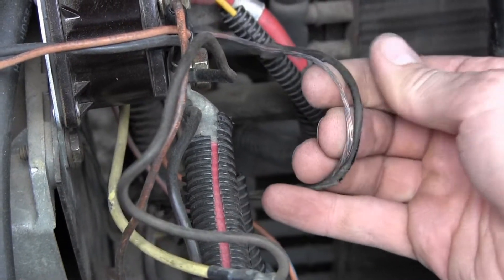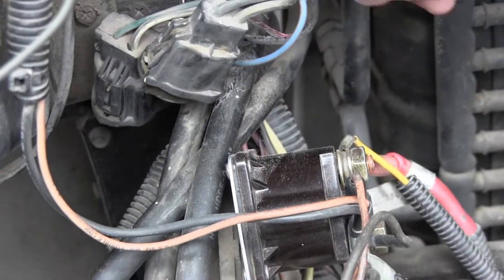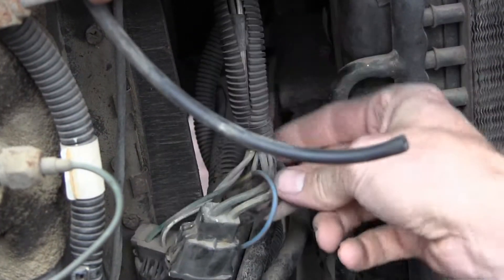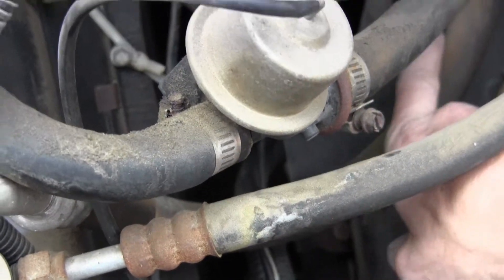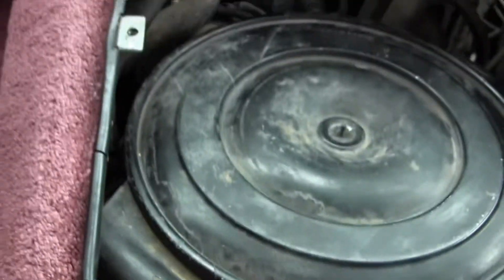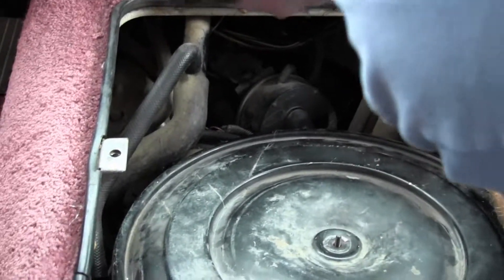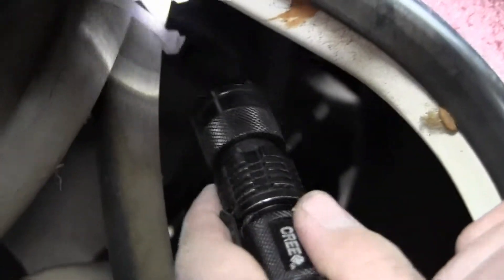You can see there's the wire and it's been burnt. I think that's a ground wire, and it shoots up into this cluster of housing, which then goes up under the dash — that's called the doghouse, the cabin access to the engine from inside between the driver and passenger seat. That wire comes up, and that housing goes right up there. You can kind of see a wire poking out. It runs along the top here. I've pulled the wires out to figure out where it was, and you can see there's a short.